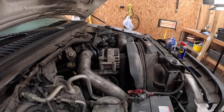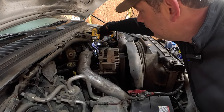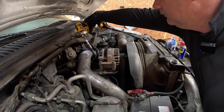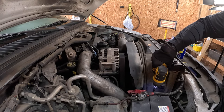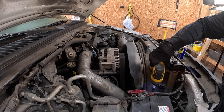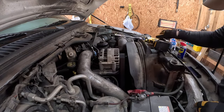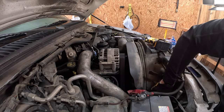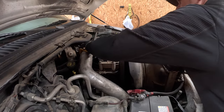Let's get to work on the boots first, then we'll let the exhaust cool down from me driving it in here, and then we'll get to work on the exhaust. The bit that we're using here is a 7/16th. This would be a really nice time to have one of those fancy auto ratchet things. Back that out. We're going to keep these clamps on here if we can. Now this clamp, we want to keep on the actual housing down here. There we go — now this should pop off, which it did.